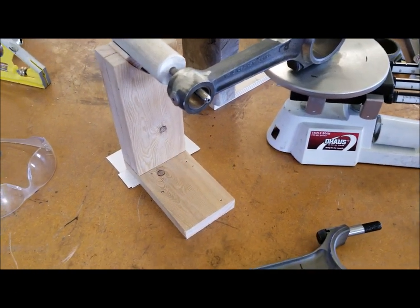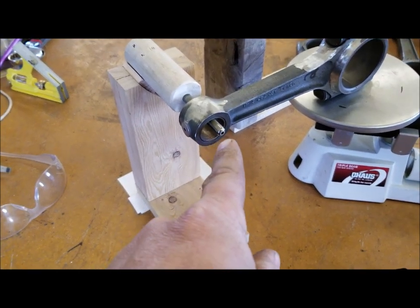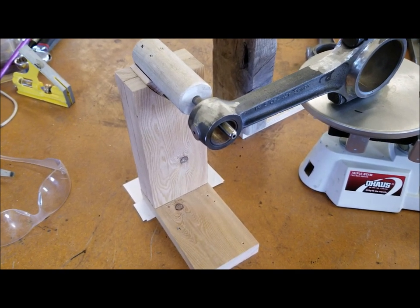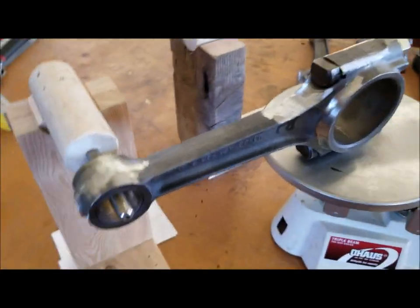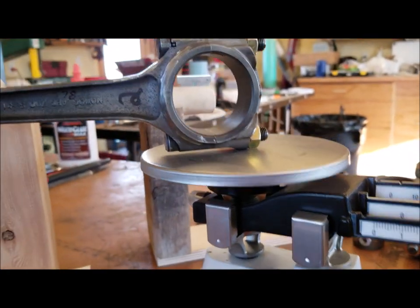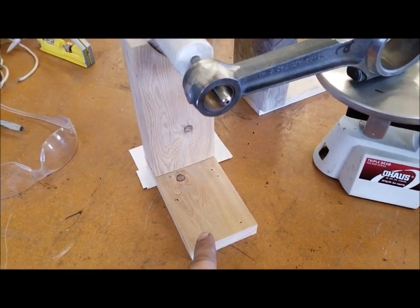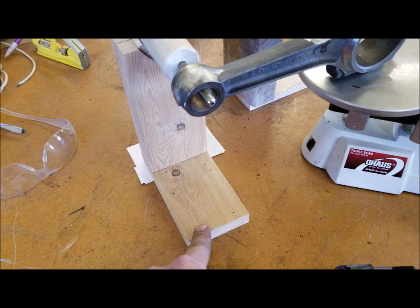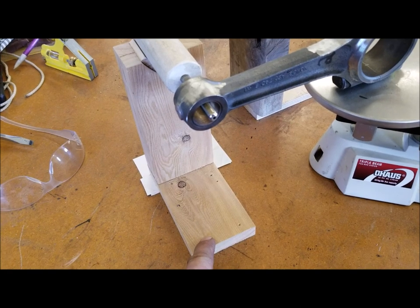What I did is I built two separate stands. This is the stand for weighing the big end. That center pin is just an old push rod that was cut in half and put in there. It's all been leveled exactly and it sits exactly perpendicular to the scale, so that when I'm weighing the big end the weight is sitting right smack in the center of the scale. Everything's been leveled and I nailed them into my wood bench because I didn't want them moving or creeping at all.